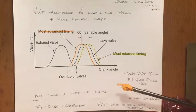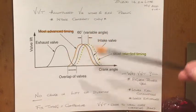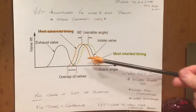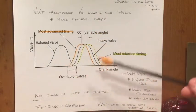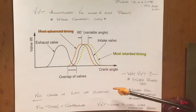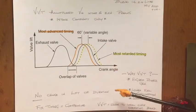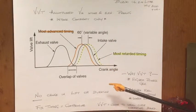There's modest increasing complexity in the engine. This is cam phasing — it only shifts in relative degrees the difference between the exhaust valve and intake valve actuation time. There is no change in lift, there is no change in duration with this system. Some other manufacturers have more complicated systems that can actually do one or the other, perhaps both, perhaps all three. We're strictly dealing with variable valve timing via a cam phaser on the intake cam itself.